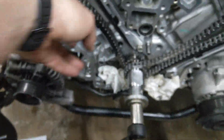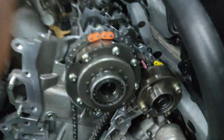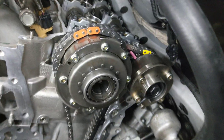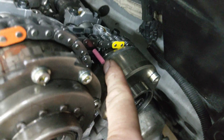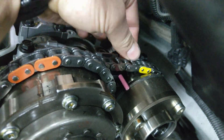So this side is done. The driver's side is a little bit more tricky. Toyota says this side is actually 33 degrees this way, and I think it says 11 degrees that way, so it's not going to be dead straight center. Same process though — you line up the marks, the little chain, the yellow mark right there. This pink thing you see is the pin; you might want to keep these for future use. You need to pull this pin out when you finish everything up, and that puts tension on the back chain because it's loose right now. As long as all your marks line up with the paint, the lines, and the crank, you know you're good.